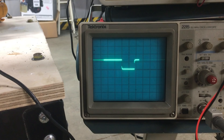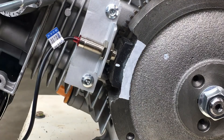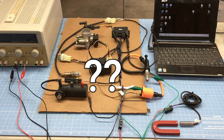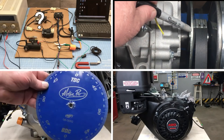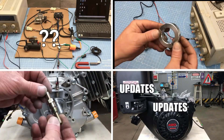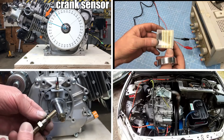There is no easy way to fix this unless you purchase the specialized north sensing crank trigger, and that's a reasonable solution. Now I could custom build a Hall Effect sensor that detects the north magnetic field — the parts are cheap enough — but that's not an off-the-shelf solution, and I think that path is not in line with the nuts and bolts kind of build we're doing. The electronic fuel injection is complicated enough, and custom building sensors puts up a barrier. When I say barrier, I mean the level of technology which the majority of the audience can understand and tolerate. I don't want to go too far out in left field just to solve a problem.